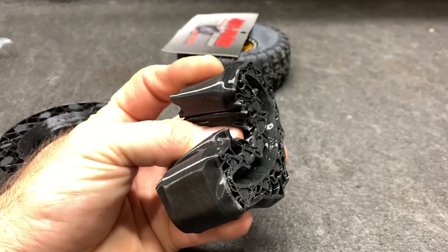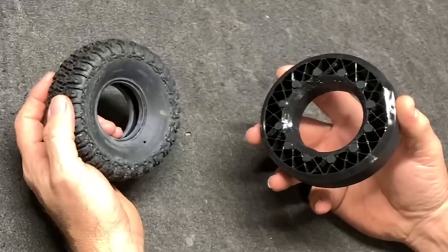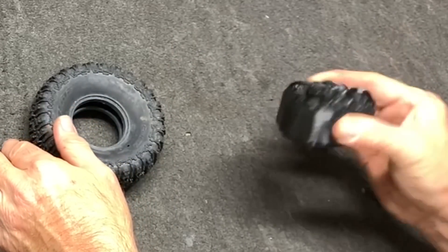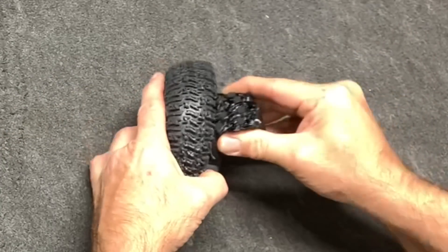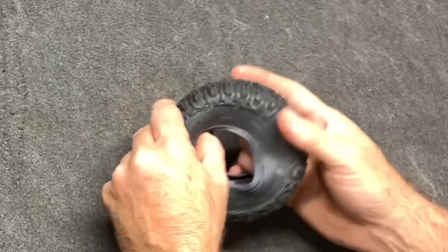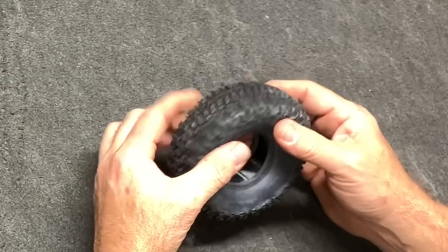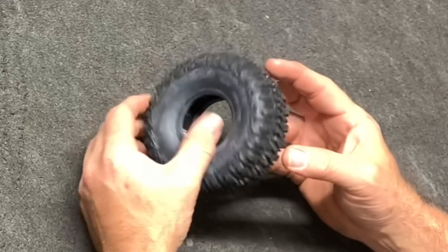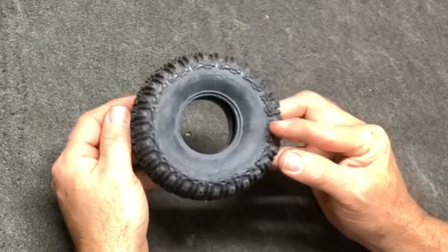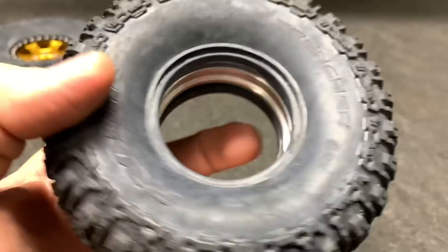Setting these into the tire is actually not bad — just kind of squeeze them right on up and shove them right on in there. Squeeze them up just like you would any foam, shove it up into there, let it expand, and that's it. If you don't have the outer foams you have to try to center or reposition them. Let's get it mounted up on the wheel — the inner ring stayed in place, it went in beautifully.